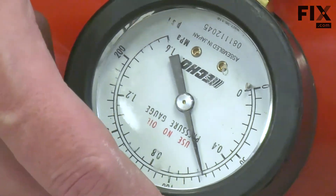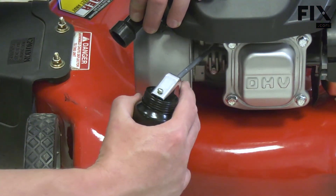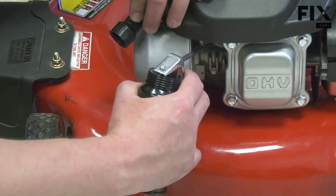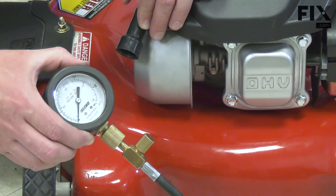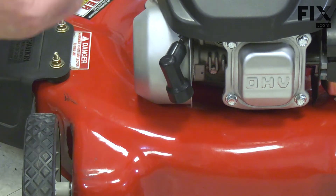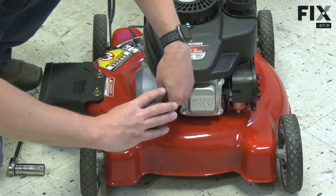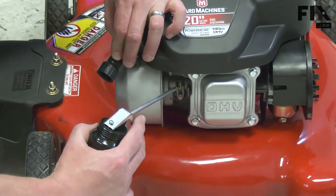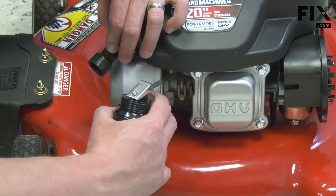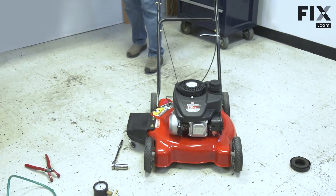Let's say our test had read low pressure. The leakage could be either from the piston rings or from the valves. One way we can test for this is to add some oil to the cylinder — this is called a wet test. That extra oil will help to seal off the piston rings. If after we add the oil we see the pressure jump 10 to 30 pounds in our test, that would indicate that our leak was at the piston rings and not the valves. I'll disconnect the tester and release the pressure, then squirt a couple of shots of oil into the cylinder with an oil can. With the gauge still disconnected, I'll turn the engine over a couple of times to distribute that oil.